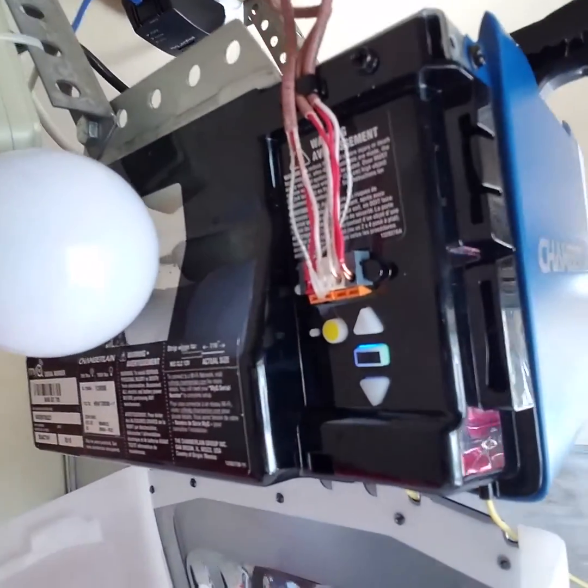itself, you go to MyQ, then device management. Then you click on your hub, whatever your hub is for your main device, and then there's a plus in the top right corner of the app, and you press that plus and you say you want to add a garage door opener. And then when you add a garage door opener, it'll say, okay, locate the learn button. Then you press next, and then it'll say press the learn button. And that learn button is that yellow button right there.